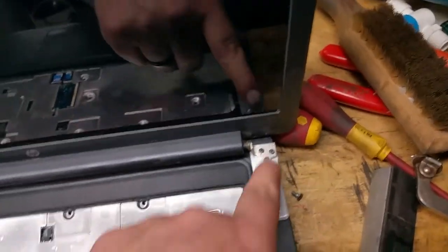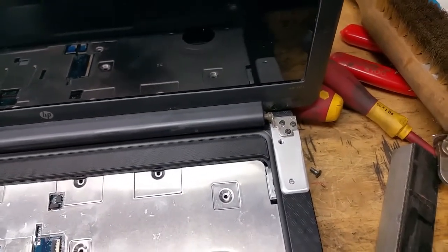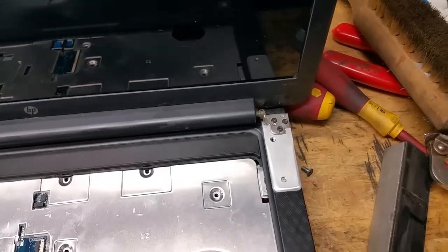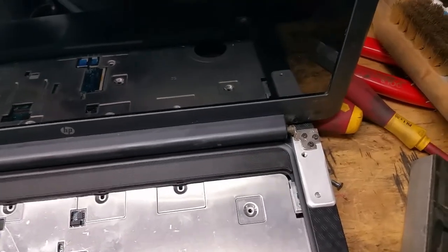Incidentally, these hinges are hardened steel, and if I had to take a stab at it I'd say they're probably in the high 50s, like a 58 RC, because they just snap if you try to bend them — it breaks like a knife blade.